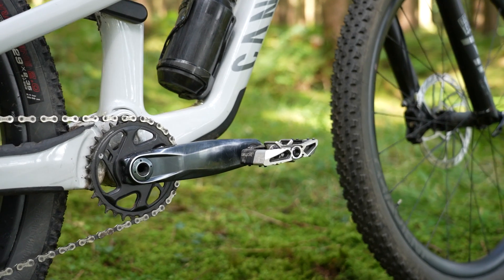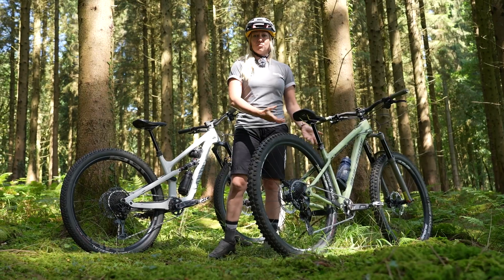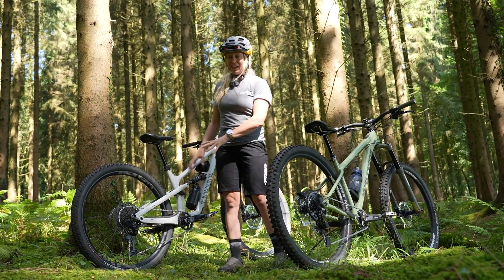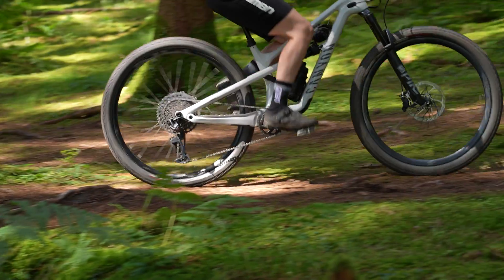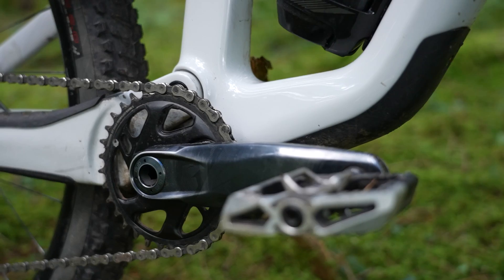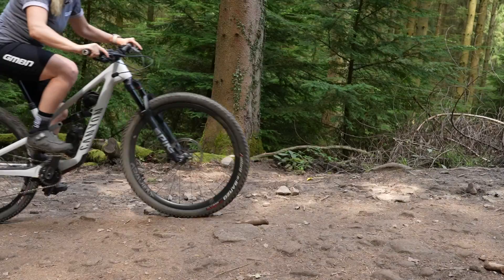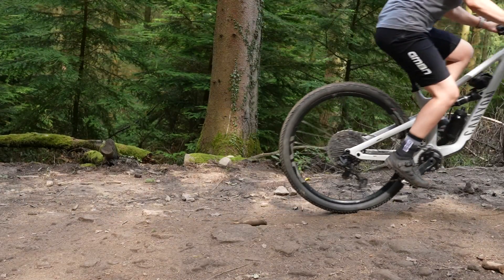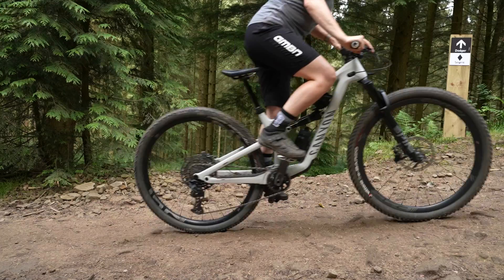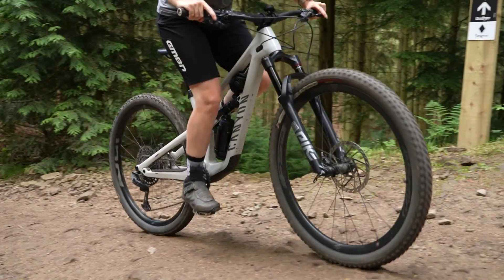There's actually a bigger problem than just chainring availability. If your chainring is too small, your chain might rub on the frame because modern bikes are optimised for bigger front chainrings. On a full suspension bike, a smaller chainring can also affect rear suspension performance. Anti-squat figures are calculated with a particular gearing in mind since chainring size affects anti-squat. A larger front chainring resists suspension compression when pedalling — more efficient climbing but a firmer feel. Smaller chainrings produce a less taut chain, less pedal kickback, and a more active suspension, but too small and it'll bob on climbs.